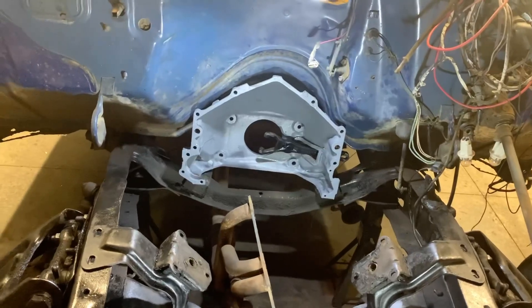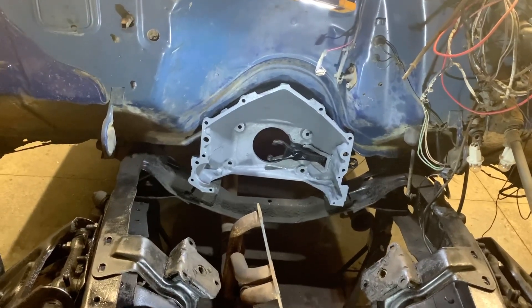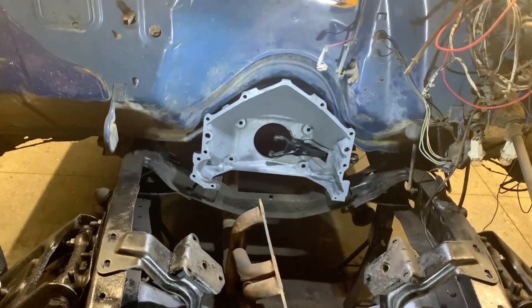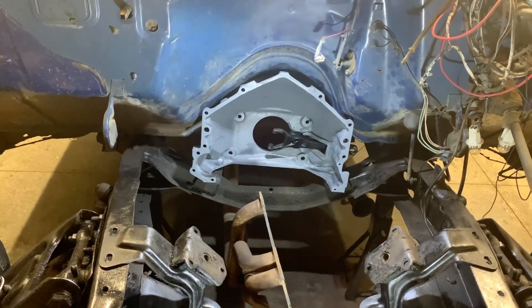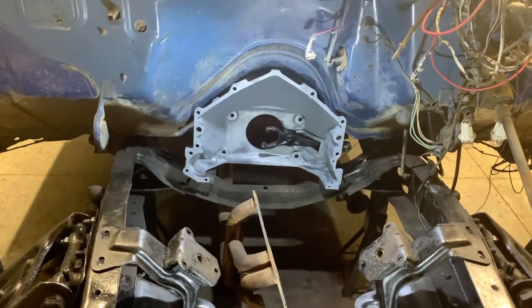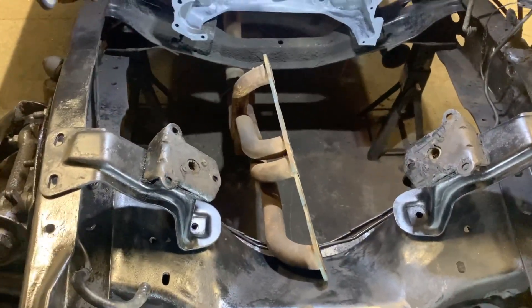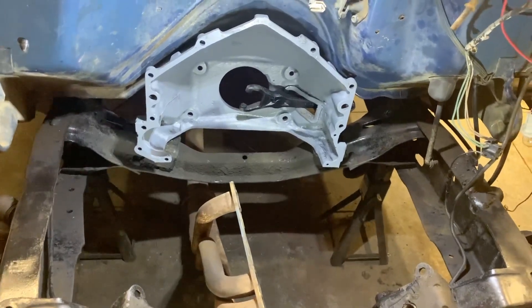So to answer the question: not a lot changes. Your engine mounts to that bell housing. You're going to reuse your starter, reuse your flywheel, reuse your clutch and all your linkage. You just swap that ball over and you'll be golden. Up here, you reuse these mounts in the stock position and you'll be set.